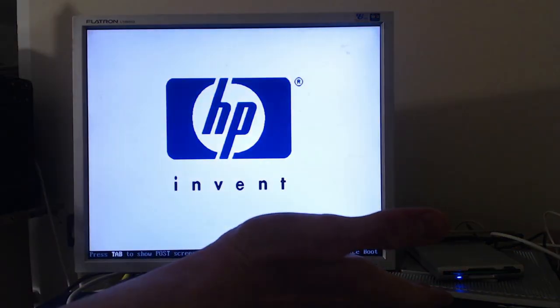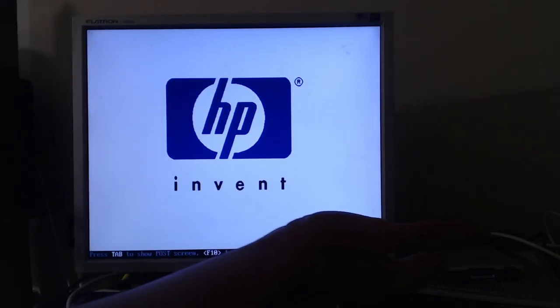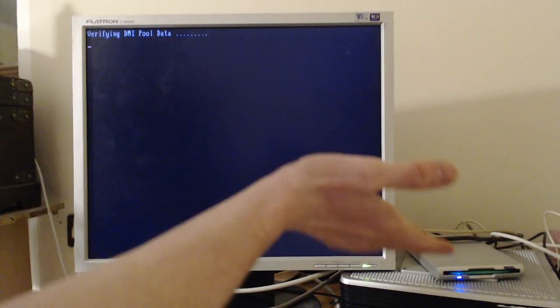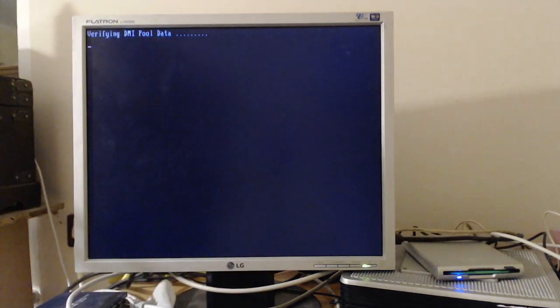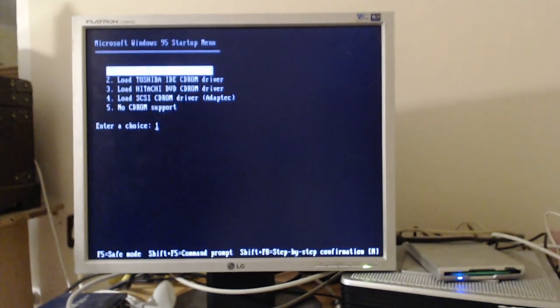I mean, they have so much space on the boot floppies, they're like 200 kilobytes. By the time Windows 95 was very relevant, everyone had at least a 720k floppy lying around. I could understand why not everything would be 1.4 megabyte floppies, but they could have at least populated 500 kilobytes with stuff like xcopy that you actually need. But well, no, they didn't.